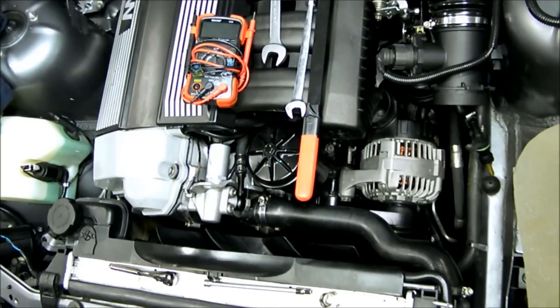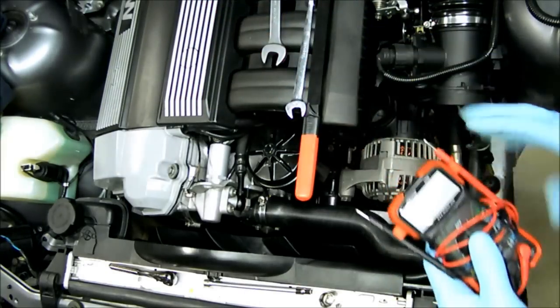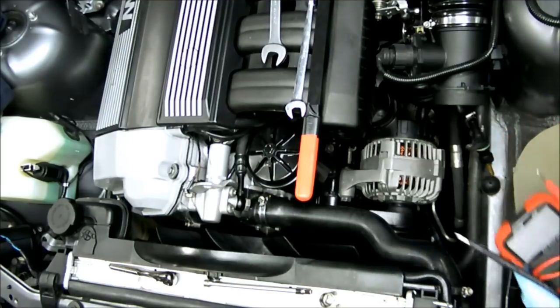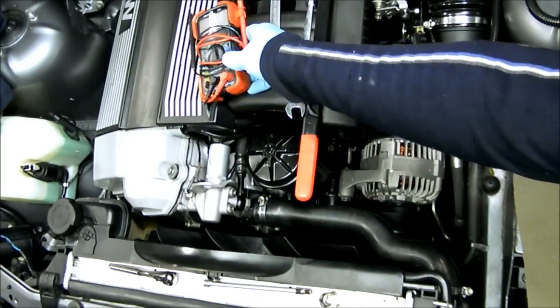And when it does hit the 18 volt mark, the interior lights flash and basically all the instrument panel lights come up for a moment and then shut down. So it's definitely very bad to have these voltage spikes. And I checked it with the voltmeter, went directly to the battery and just measured the voltage off that as the engine was idling to monitor that voltage spike.